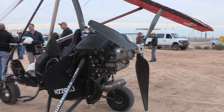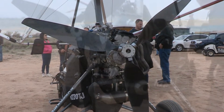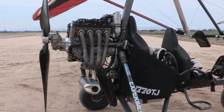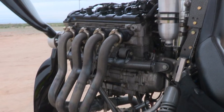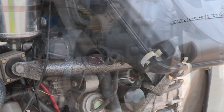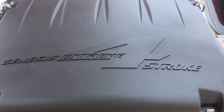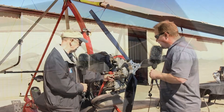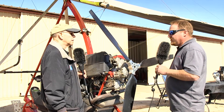This is the exact same engine they use in their snowmobiles. A homebuilder might find one of these engines with low time and want to use it, but they may not run at the right speed to run a prop. One thing I do recognize is the gearbox. This is a Rotax C gearbox, and I've manufactured an adapter to bolt the C gearbox directly to this engine. You basically remove the stock cover and bolt the gearbox right onto the engine.